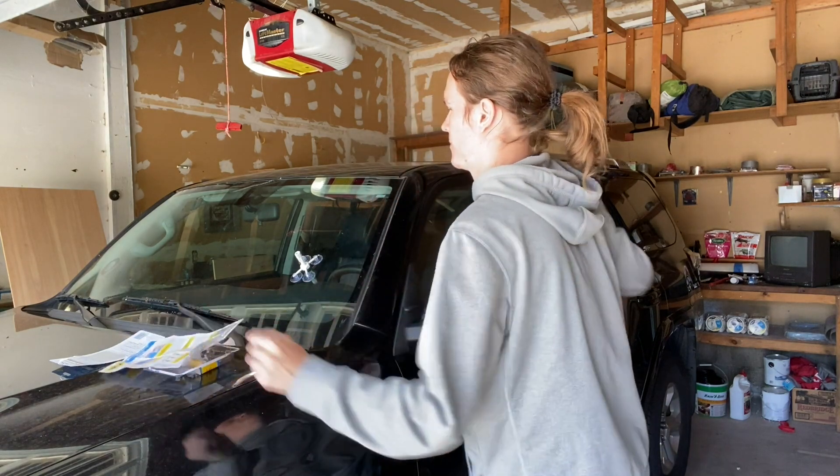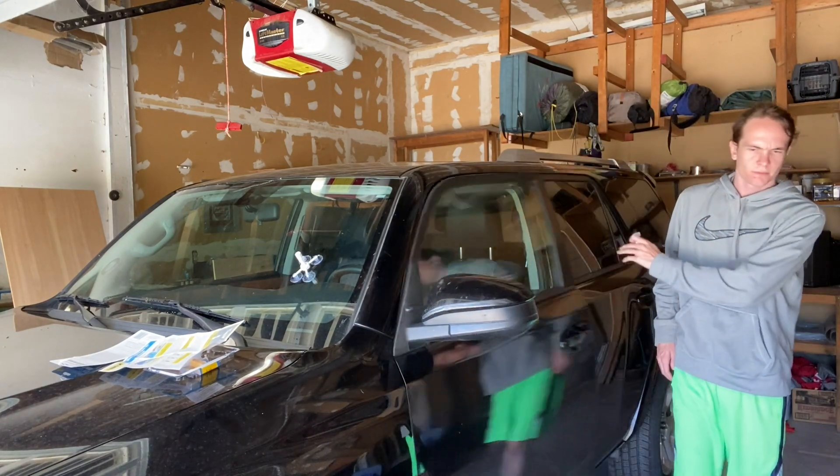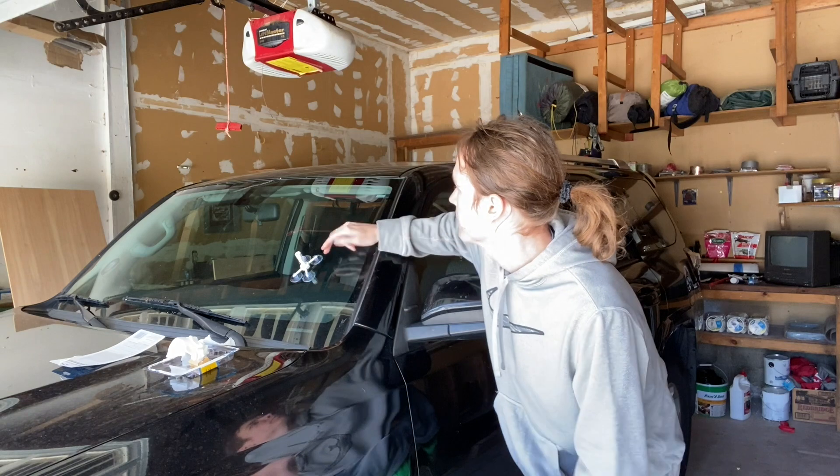If all the lines are starting to disappear when viewed from inside, you know you've done enough and can remove the apparatus. Reading step five — we keep repeating steps four and five: adding resin, twisting it in, waiting four to five minutes, pulling out the plunger, and pushing it back in to get rid of air bubbles. You can add more resin if the chamber is empty. For a bullseye type crack, look from the back — if you still see green or black crack lines you need more resin. I can see a couple of spider lines still greenish-black, so I'll do one more cycle.